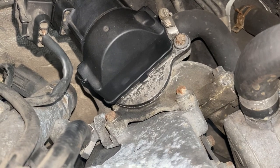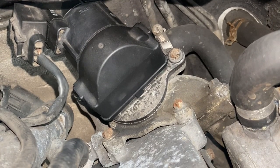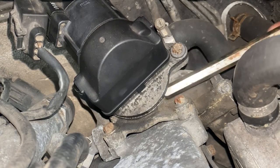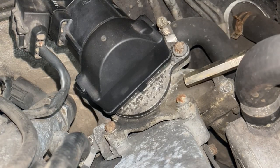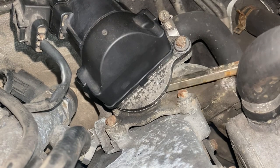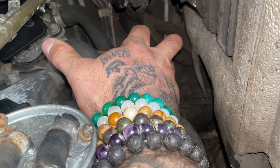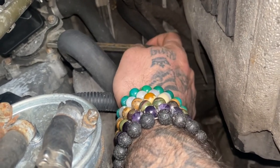Right, okay guys, so this is my little trick that I got shown years ago, how to take this EGR valve off. Now, I'm going to show it to you this way, because when I start stripping it, it's going to be hard for me to show you. I use a big Allen key. And just behind here, as you can see there, there's a tiny little groove. You might see I rest it on there. So all that I do is rest it like that. I'll pull it out a bit. So it's rested on. When I'm going to do it, I'll hold there where my thumb is, and you hit this with the hammer, only slightly, and what happens is it's like a lever, it goes push and it pops it up.